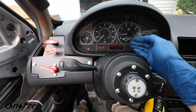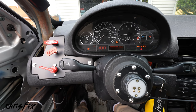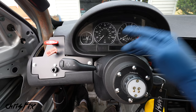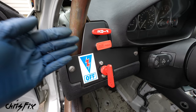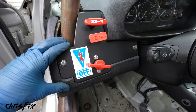Okay, clutch in, let's try starting her up — she's alive, that's a good thing. I let the engine idle for a few minutes and she's running perfectly. When you rev it up she has plenty of power. Now at the race, in order to pass tech inspection and get on the track, we need to be able to rev our engine over 3000 RPMs and hold it there, and then the tech inspector is going to flick the switch off and make sure the engine dies quickly. So let's give it a try — let's get our RPMs above 3000 RPMs and hold it steady. Alright, now that's what I'm talking about. We had the engine above 3000 RPMs, flipped the switch, and it killed everything instantly — we have no power at all. So now we know we properly installed our kill switch.